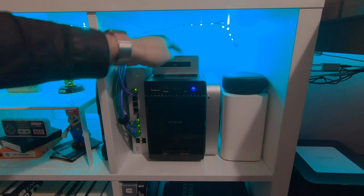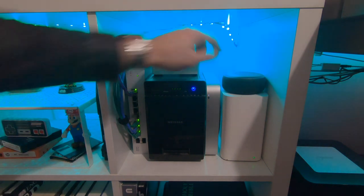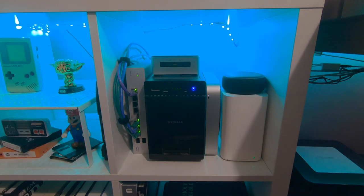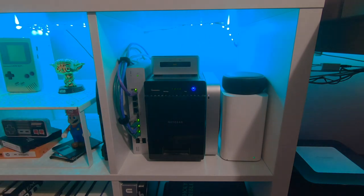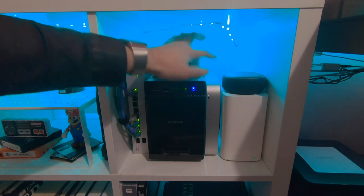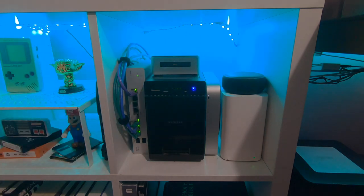Right here I've got two computers. Additionally to my MacBook Pro, which is my primary computer on my Wi-Fi network, I've got a couple of additional computers here. This is an Intel NUC, which is a very small form factor computer, and also a Mac Mini. These two devices are what's running VMware ESXi, which is essentially some virtualization technology which allows you to run multiple computers on the one device. So rather than just running Windows 10 or Mac OS, I've installed VMware's operating system ESXi, and I've got a number of VMs — Ubuntu servers and Windows servers all running on both of these.